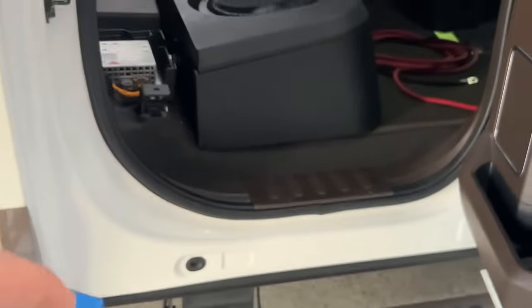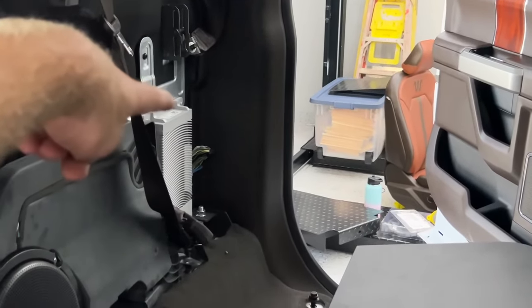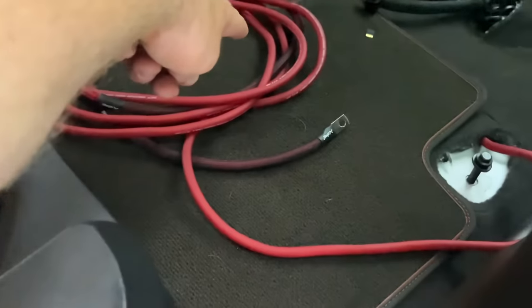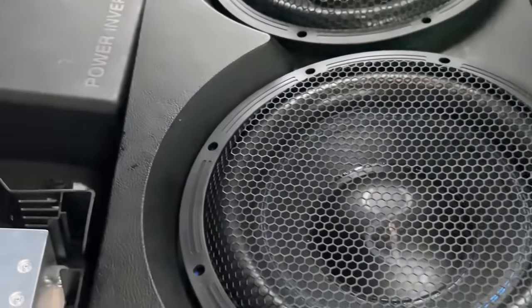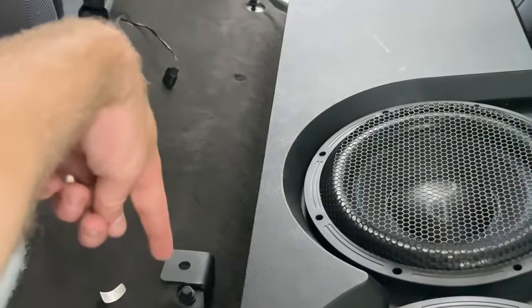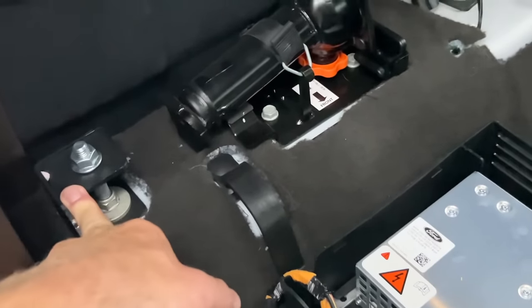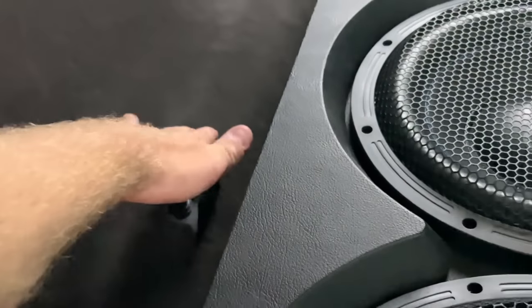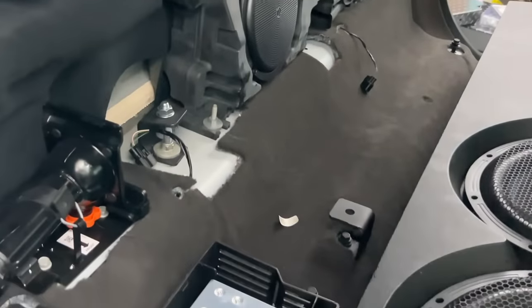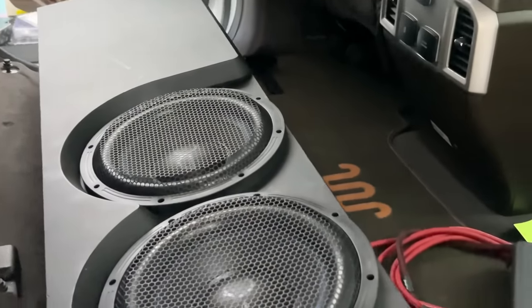So we've got those two features already built into the amp. All we need to do is tap into some speaker wires from the stock truck amp, run those to the sub amp, and run our power wire back to the floor. We're running a special amp bracket that's going to sit right here between the seat bolts. We also had to do a two-and-a-half inch seat lift so the back seat sits a little higher. I'll put a link in the description for all these parts and pieces.